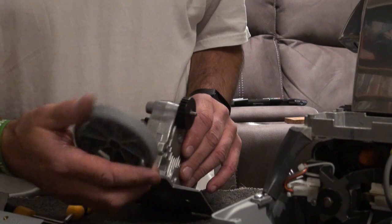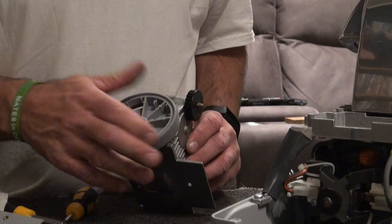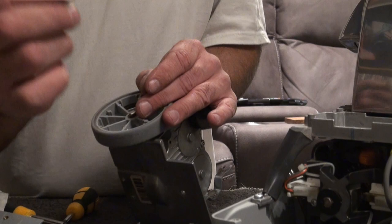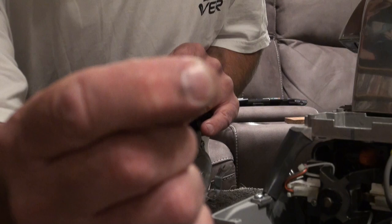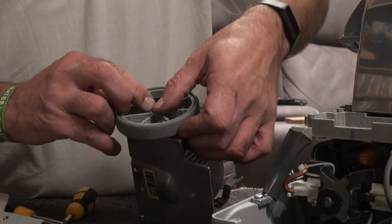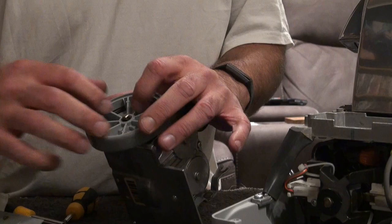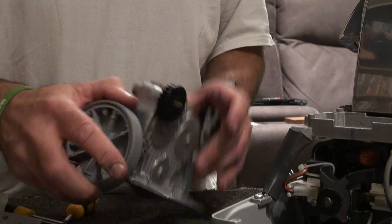Okay, then I'm going to put this back on. So this is a flat part, so you hang that flat part there, on it goes. Push the axle through, and over here we have our little split clips. As you can see, the little flat bit at the top goes on the flat side. So just hook it over, push it in, press it down till it clicks. Twist, make sure that wheel doesn't come off, because if that comes off with your hubcap on, you're going to end up losing the split clip. Okay, so that's fully on, that's not coming off. Okay, we'll do the other side.